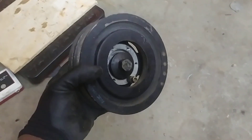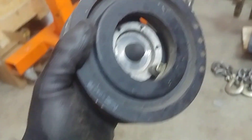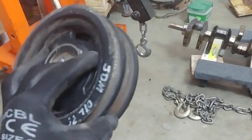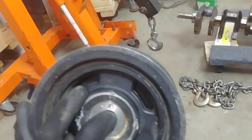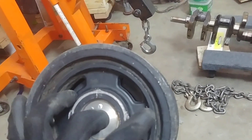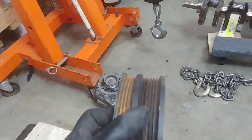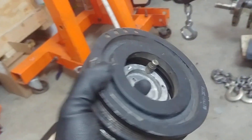Saving the best for last — the crankshaft pulley. Here we have this pulley, also called the harmonic balancer, vibration damper, or vibration balancer. It's a three-piece component: you have an inner metal hub, you have the elastomer — the rubber piece in the middle — and then you have the outer ring which has the grooves that drive your accessory belts.